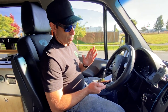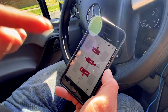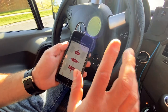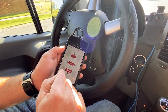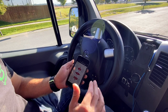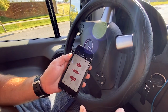The next step is to download the Falcon app — it's free, just go to the app store and get it. Pull up the Falcon app and it should connect to the module right away. The module is mounted under my seat. With the van off, the screen should read red. The first time you connect it might take a little longer, but it should connect right away. When the shocks are red, that means they're in firm.